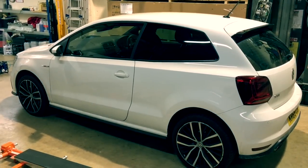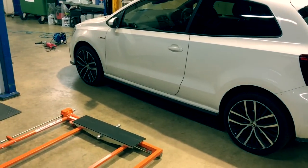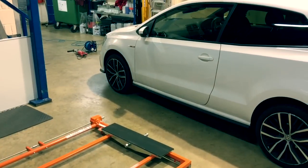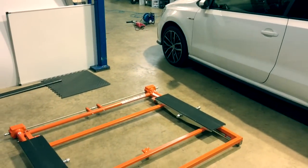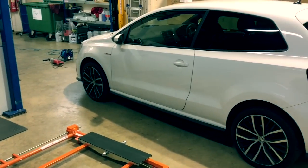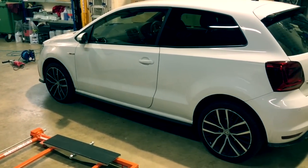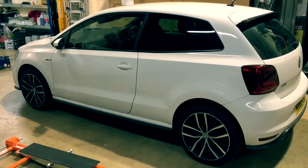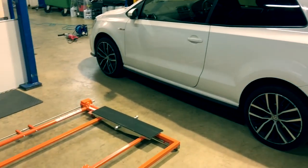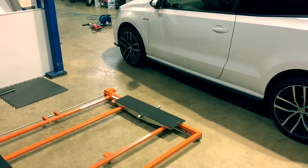There's a rule of thumb that applies. If it's a front wheel drive, front engine vehicle, what you would normally do is have the gearboxes of the 3000 towards the front wheels. We're now going to pick this VW Polo up and show you how easy it is to tilt the vehicle once it's up in the air, which is a unique feature of the Autolift 3000.